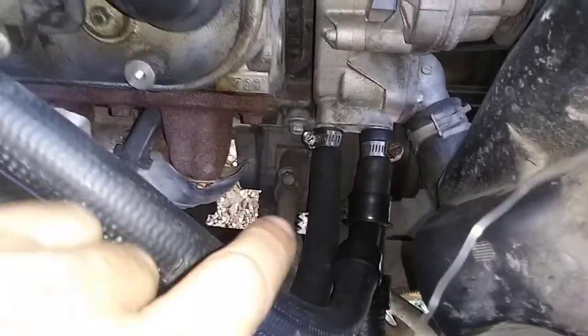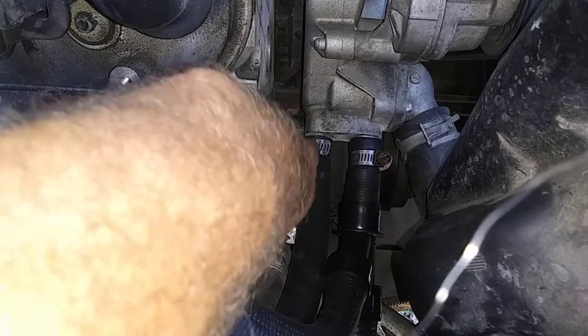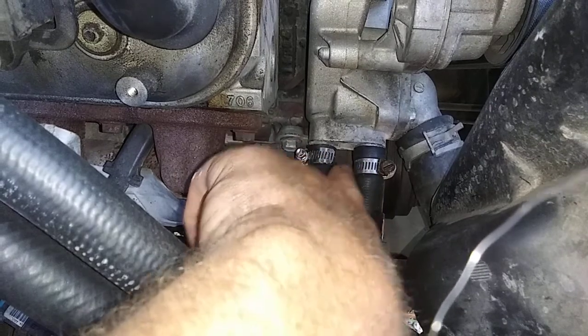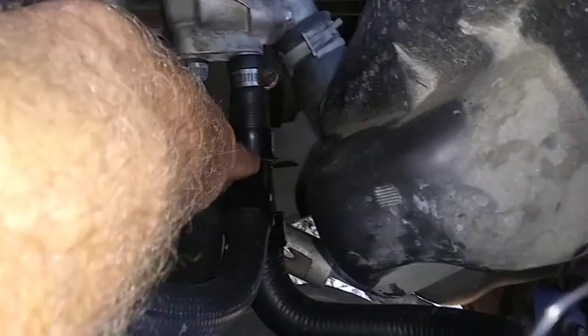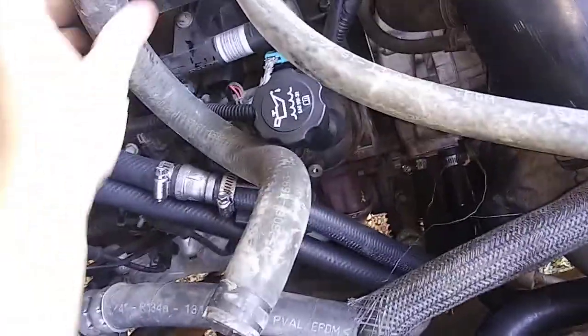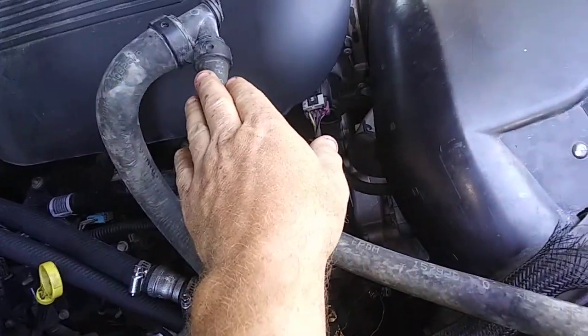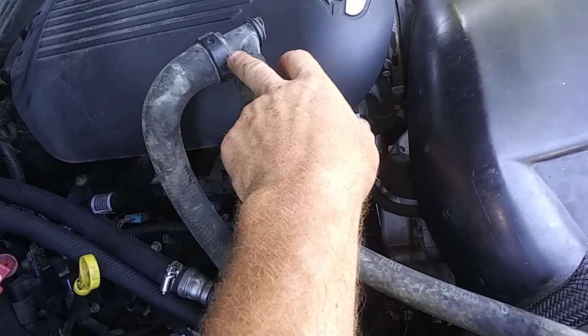Then you just have a regular hose. There was another fitting down here, and this one down here goes into the inlet on the water pump. Down on the water pump there's a Y-fitting — a plastic fitting — and this one was also brittle and weak; it was just a matter of time before that broke too. This also goes to the overflow tank right there. I couldn't find any plumbing fitting from a local home improvement store that could join the two.